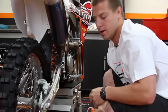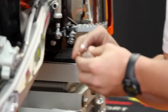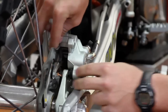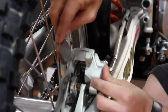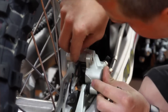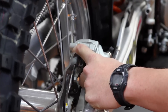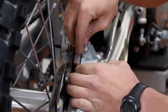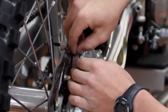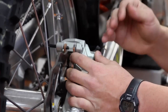I've got my new KTM pads here — real fresh. Again, the insulator goes to the right, so it's on the outside. We're just going to install these. I start with the rear — make sure you watch, there's a little channel that this rides in. You kind of want to lift up and let it just fall right in there. It'll feel right. Then line it up with the hole. If you'd like, you can start by putting the pin in to hold that one. And of course the insulator one goes in the same way — you can look under there to make sure it's in the groove. If it lines up, you're pretty well off.